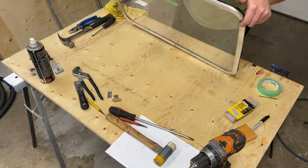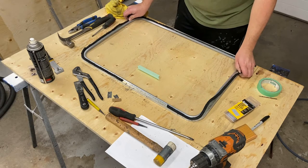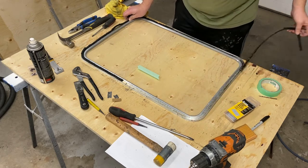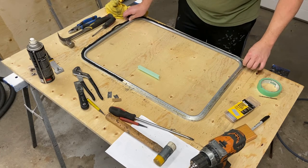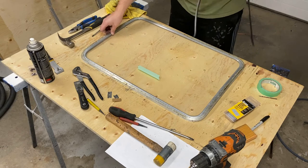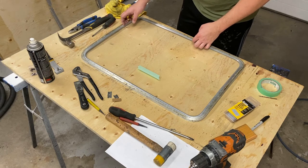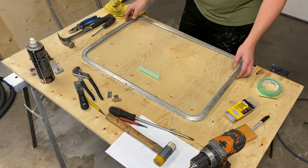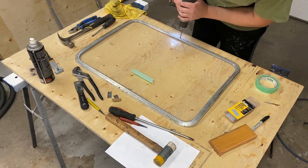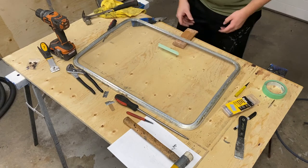This is the curbside rear interior window sash — this is the one that gets screwed into the exterior. I'm going to peel all of this gasket off, then we'll have to use Goo Gone or Goof Off to get this sticky adhesive off. Continuing with replacing all the gaskets to make it next to new, I'm going to go ahead and get this inner window sash taken apart, starting with the rivets on the top side.